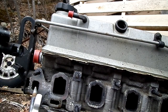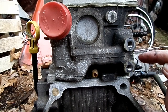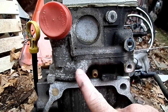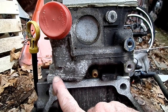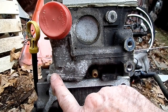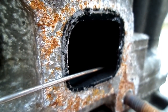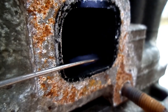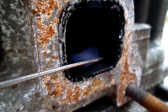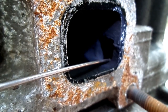If it was blocked, it would blow out this side. Now we're going to go over to the other side. Here is the port through the cylinder head, and here is the wire right here. You can almost see the runner right here — that's what you're trying to clean out. We've got the wire all the way over to this point, so now we have to come in through the exhaust port. Here is number four exhaust port — I've got the wire in it. If you keep putting the wire in there, you'll be able to chip away at the carbon right there.